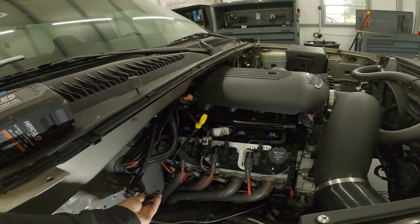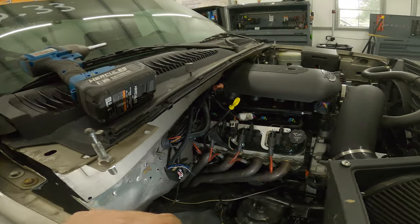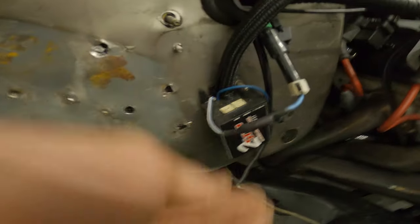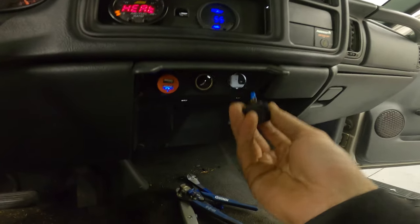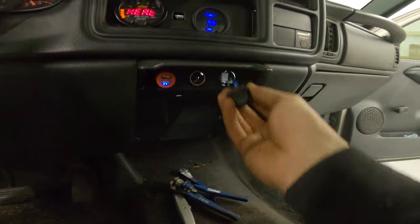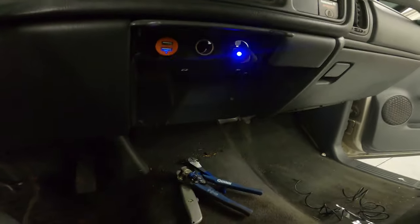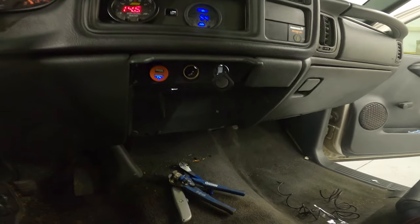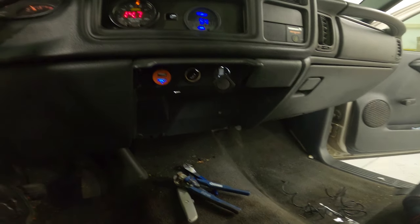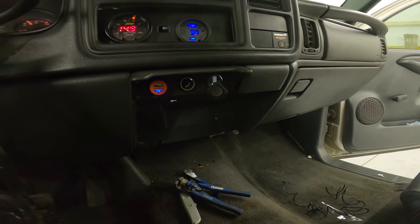Now we just have to run one wire from the brake pedal to this. I'm going to put mine on a toggle switch. I got my plug soldered on so it just plugs in — going to the white wire because I'm providing power to it. So what I've got here is the switch wired in: it runs from the brake pedal to the switch, out the switch, to the two-step. As you can see, if I hit the brake pedal it'll light up letting me know it's armed. I'll show you from the engine bay — when I hit the brake pedal you'll see the red light come on showing it's armed. That handles the wiring.